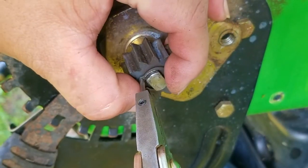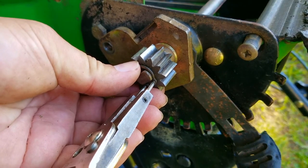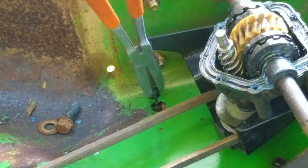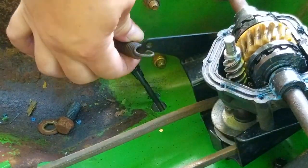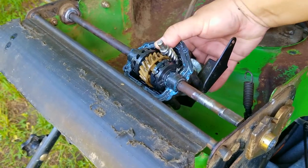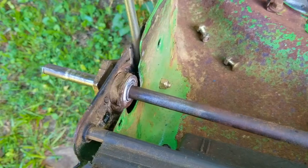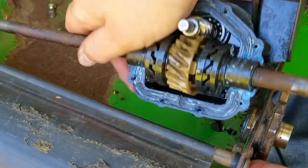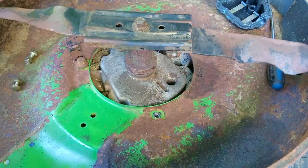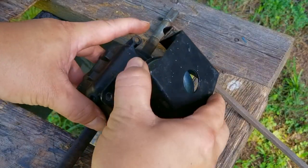Once the plastics are out of the way we need to take off the drive gears. It helps to use snap ring pliers, but if you don't have any you might have to get creative. Be careful — if you damage the snap rings you'll need to replace them or they may not keep the gear on the axle. After that we need to disconnect the self-propelled cable from its anchor. Sliding the assembly to the left frees the right side, but there's not enough slack to slide out the other side, so we take off two bolts holding the plate with the bearing to the deck. After that we lift the loose end above the deck, slide out the other side, and remove the belt from the pulley. I'll also take off the belt guard in case we need to replace the top seal.